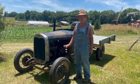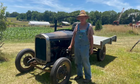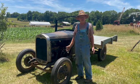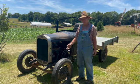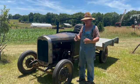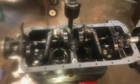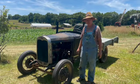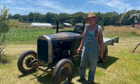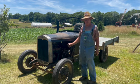So our buddy Charles Ward, I took it over to his shop, and we replaced the one rod. We actually bought one from Snyder's. It's already babbitted. You can swap them out for $100, and that's a pretty good deal. And then the others, he took sandpaper and just filed the end of the rod caps off and got them down good and tight, put it back together. James Crane helped us put it back in. Daniel Perkins and Sam Chasen helped us some on that too. We got it back together.